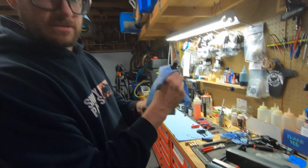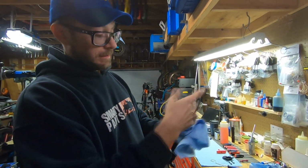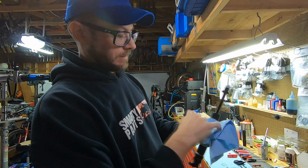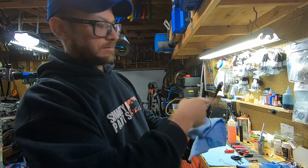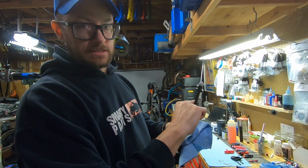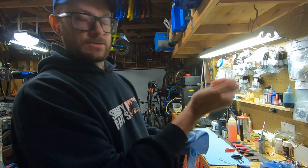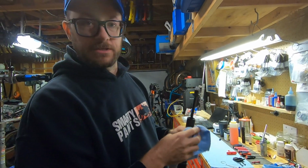This is a sealing surface, and so this keeps oil and air, depending on what type of post you have. If it's a stealth or non-stealth, sometimes these do different jobs. But no matter what, this is a sealing surface. So any scratches on here totally degrades performance. If you get really bad scratches, it lets oil leak, and then the post eventually just fails.